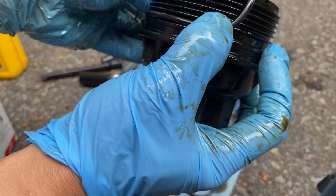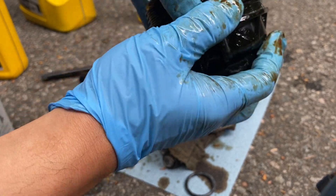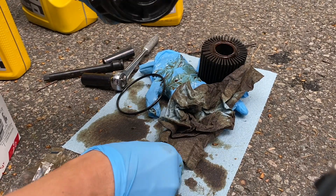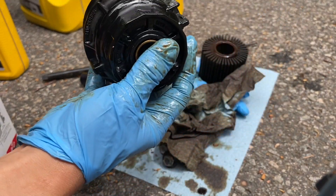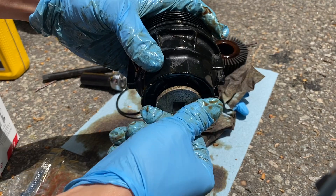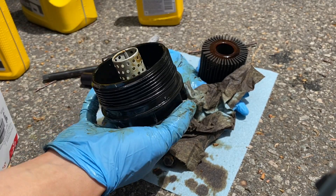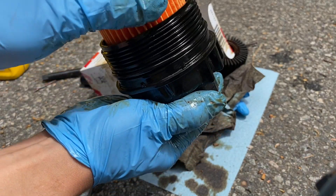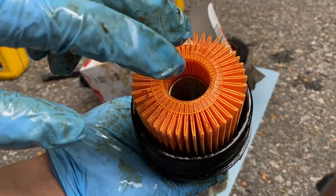So it's all in there. The bottom drain piece — removed of debris — can go right back in here, as seen — it goes right in there. After that you can use your 3/8 drive and put the socket back in. We're going to hand-tighten this back in. And then we're going to put our new oil filter in. I'm also going to prime it — priming your oil filter means you're going to put a little bit of oil in here so that the oil filter isn't dry when you put it back into its location.